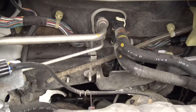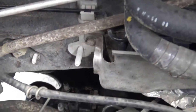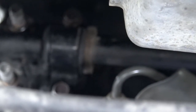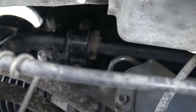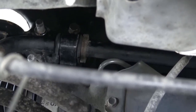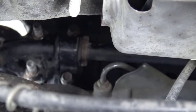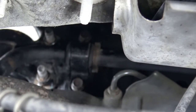There is another view of the sway bar mount that you can get from above inside the engine compartment looking down. Here you can see more clearly that there's a metal collar on the sway bar, and the sway bar bracket and rubber bushing are on the outside of that collar towards the wheel side on both ends of the sway bar. You can also see the two bolts that we're trying to reach. It might even be possible to reach from above, at least the front bolt, if you had extremely long extensions for your ratchet. Otherwise you've got to do it from underneath and from the back.